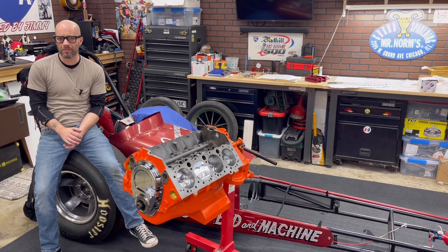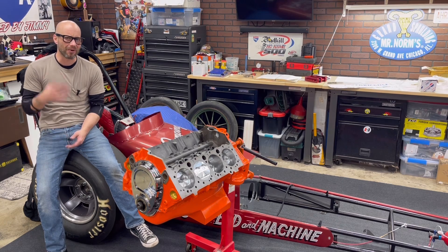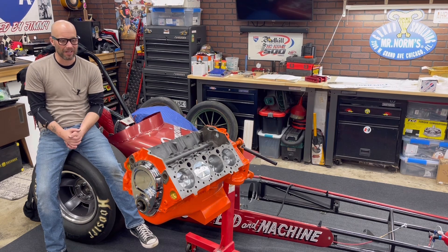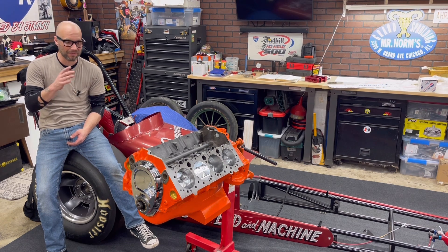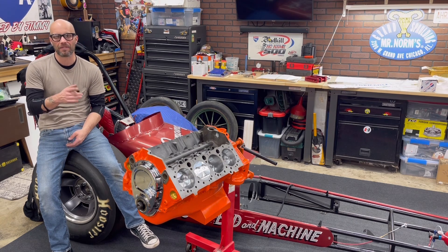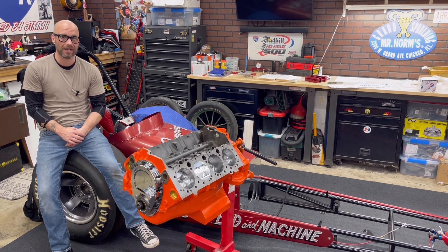There you have it — the oiling system is done, except I didn't order the dipstick and I need to get the oil filter bypass adapter on there. Everything's on order, just waiting for that. But it's really starting to come together and look like an engine again. This thing's a really fun project and I can't wait to hear it bark off. With this camshaft and compression combination, should be around 10.5 to 10.75 to one — it should sound pretty poppy for such a small cubic inch engine. With that, 2Hacks Garage, we'll see you in the next one.